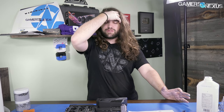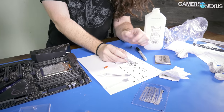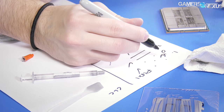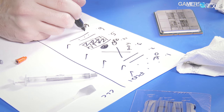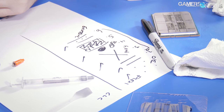A bit much on the thermal paste — kind of unavoidable. We're going to do something more proper now, applying an actual CLC with real proper mounting pressure that's more even across the die area and across the IHS. We finished applying all the thermal paste with a couple different variants — one variation of the blob method with a small and a large, and a slightly larger large blob. We removed the full coverage thermal paste spread from the equation, as that makes more sense with something like the Noctua full coverage plates.